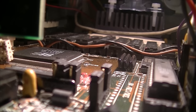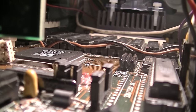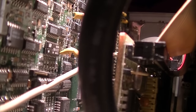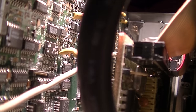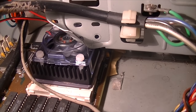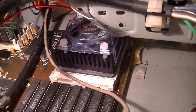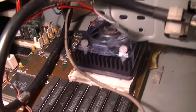The SIS chipset has a real PCI and ISA bus which are completely separate. Not uncommon at the time, but who knows, someday I might look at a system which uses a bridge and this information will then be relevant. That's pretty much it. The motherboard is nice though and it supports 60MHz and 66MHz processors. Which is all you could do with the original Pentium. It never went any faster. I believe there might have been overdrive chips for it, but I don't have one, don't really want one, and don't know how well they worked if they ever did exist.